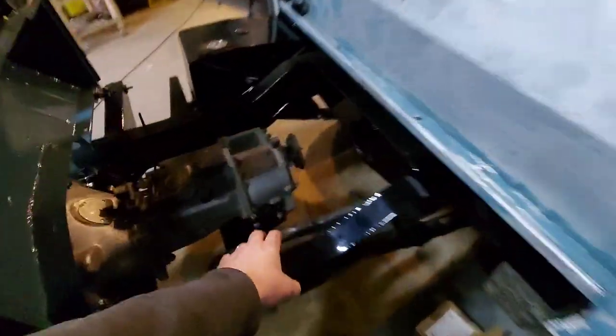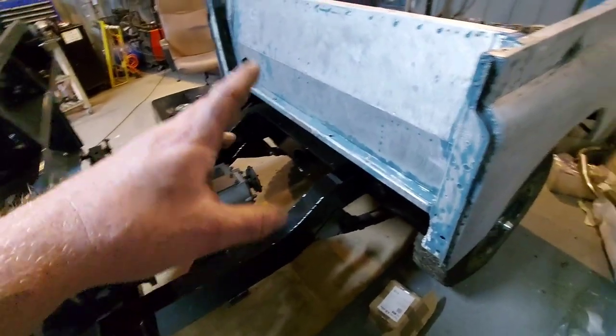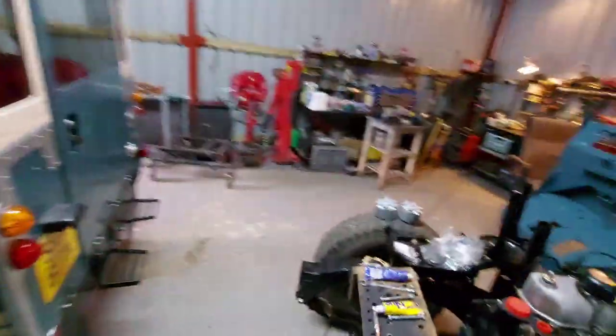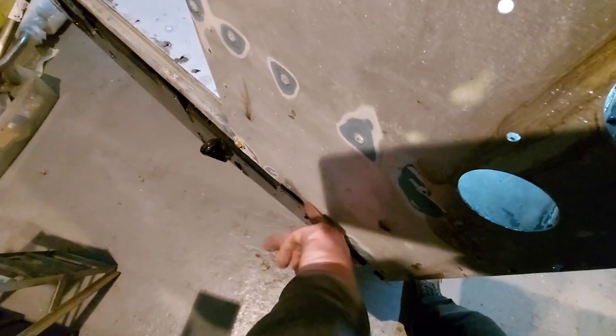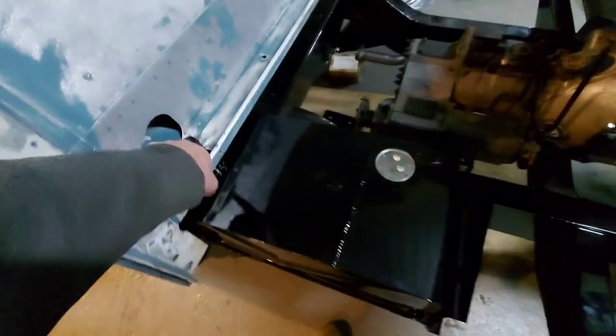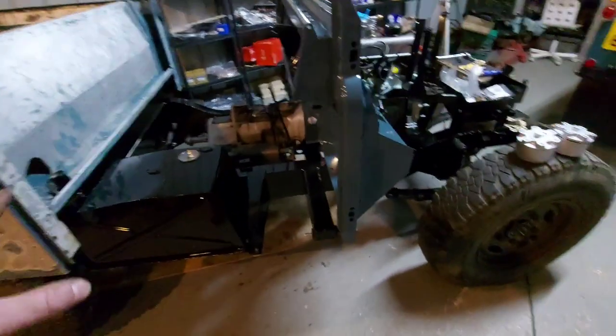What I've decided to do now is just leave the exhaust at that for now — it's resting on top of that gearbox mount there. I'll take this tub off before I finish the rest of it, but I've got nobody here to help me lift it off today. I need to drop the tank to fit the tub. This is a brand new tank, and for whatever reason it needs to go that way more for the tub to fit. This is why we always test things before we paint them — see the big gap there? The tub won't come any further this way, and it's the tank that's stopping it. I might have to just elongate the holes a bit on the tank to get it to shift half an inch.